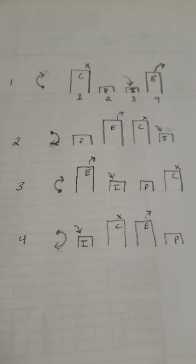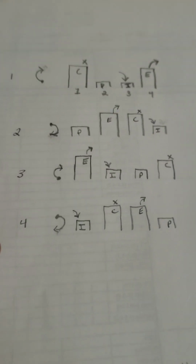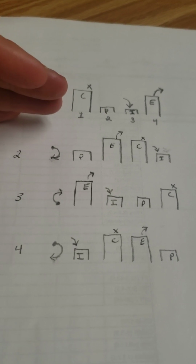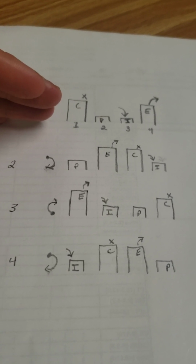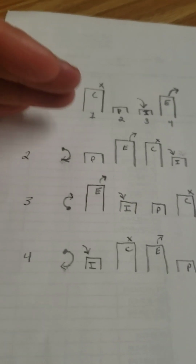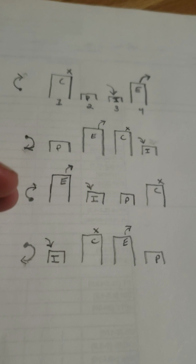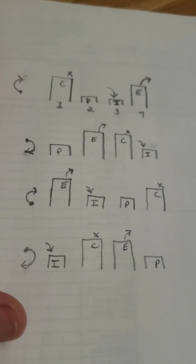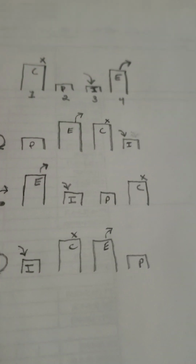So the biggest pain in the ass for me is when you're doing this by yourself, you have to set up your compression or your leak down equipment, do 1 cylinder, then go lay on the ground, turn your crank, find top dead center for the next one, and like so on and so forth. So this very good drawing is trying to show you the most efficient way to do this.